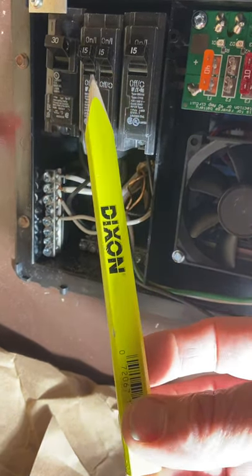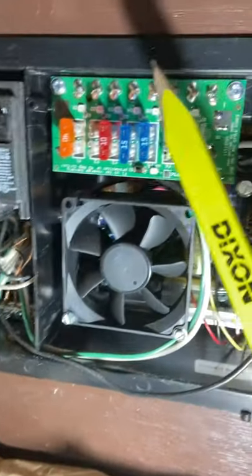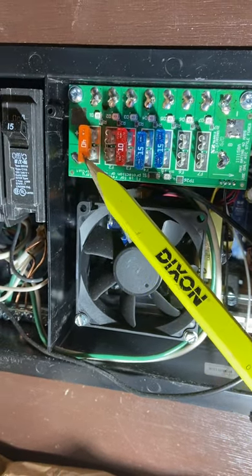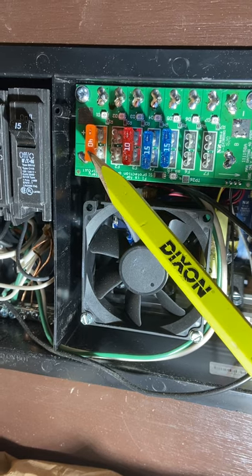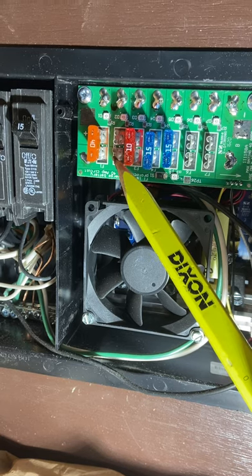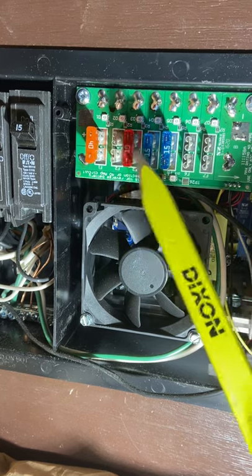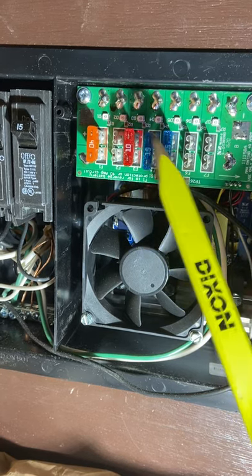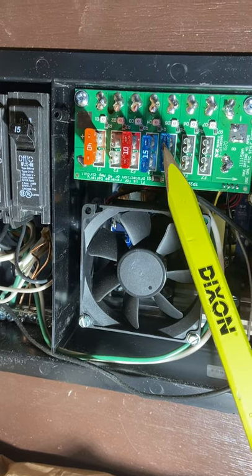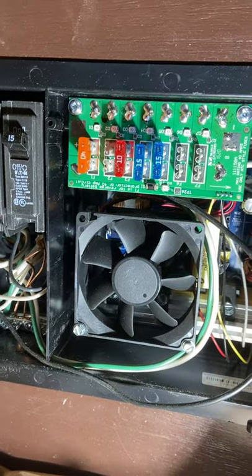The converter comes over here, and then I've got my DC side — 40 amp, which is for the battery. I'm skipping this one here; this is a heavier gauge wire to hook up something — I think it goes up to 30 amp. I have three of the branches being used right now, and I still have two more that I don't have hooked up to anything. I put in fuses based upon what I'm running off them — you just need to know your amperage for that.